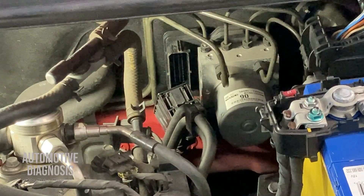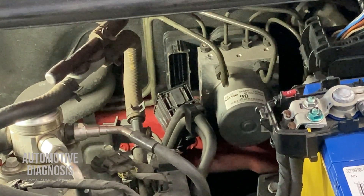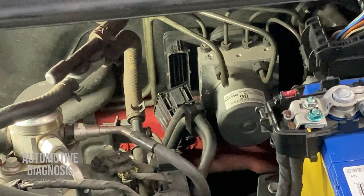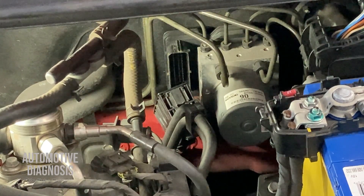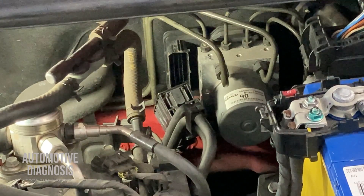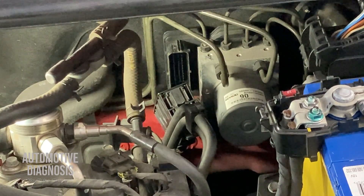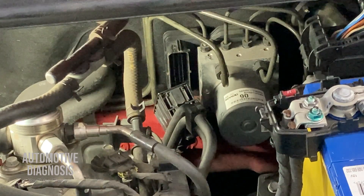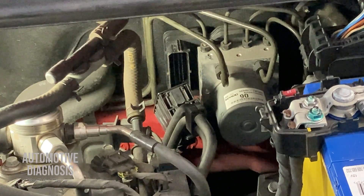So we already checked the fuse, the power supply for the ABS motor on the ABS module, and the ground. At any step, if you find a problem you get it fixed. But if you don't find anything wrong, the problem could be internally inside the ABS module. That's why we have two other videos in the description for inspecting and repairing everything inside the ABS module, explaining everything exactly for this fault code. Thank you very much for watching — I hope you enjoyed the video. Please don't forget to check the channel page for more diagnostic videos.